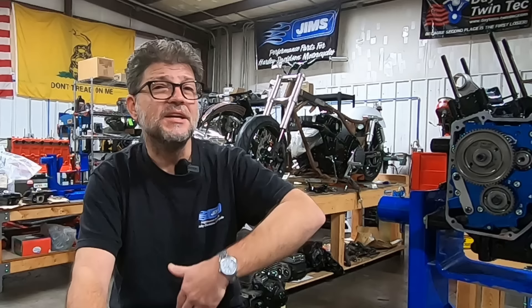And if they sat long enough, oil would drain into the crankcase through the oil pump, filling it with oil — also known as sumping. Sumping isn't new. When you fire the bike up, you would get this huge blast of oil out of your crankcase breather, but that's for another episode. By the end of its run, the Evo had become a very solid, long-lasting powerplant. I can't completely agree that AMF was bad, nor can I agree that the Evo engine alone is what saved the motor company. It was AMF's money after all that began the development of the Evo engine.